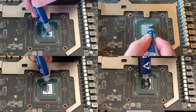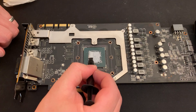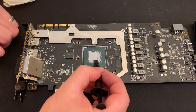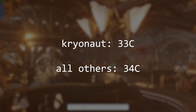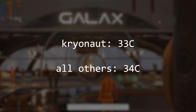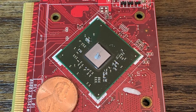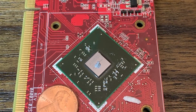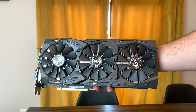Does this mean all four methods will equally cool our GPU? Yes, it does. Each managed a max GPU temp of 34 degrees Celsius over the max ambient temperature. To make sure nothing funny was causing these identical results, I ran the same test using the thin layer method but with Thermal Grizzly Kryonaut instead, which should theoretically perform a bit better than Arctic MX4. The Kryonaut measured a max temp of 1 degree lower at 33 degrees Celsius over ambient. I also ran the test with different fan speeds, which did produce a different max temp result.